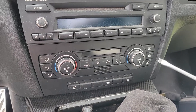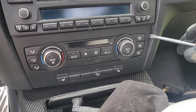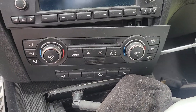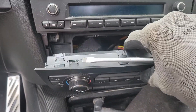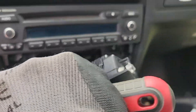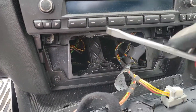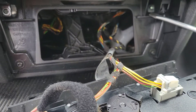The only thing you need to do first is remove your heater control unit. You get in on an edge here and it simply just pops out. It's not held in with any screws or fasteners — it's just held in with clips. You don't even have to unplug it; you can just set it to the side.